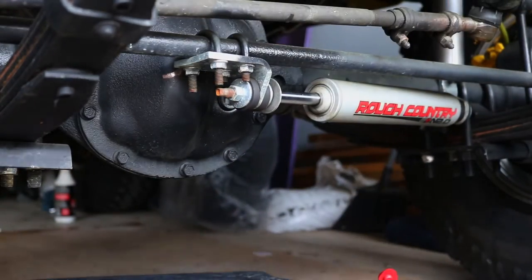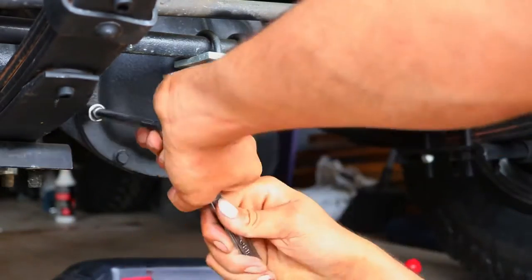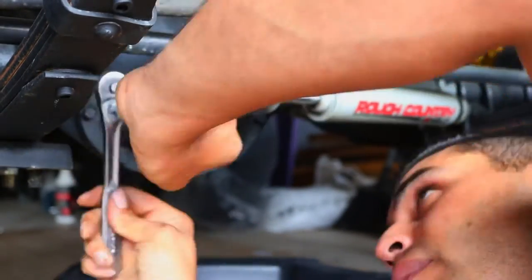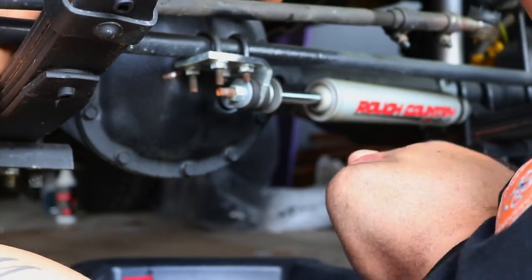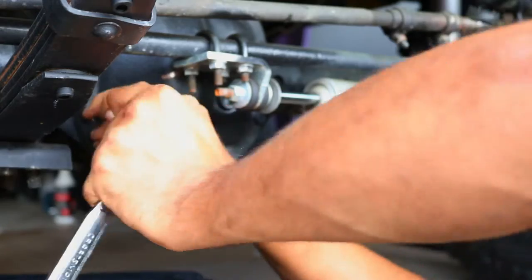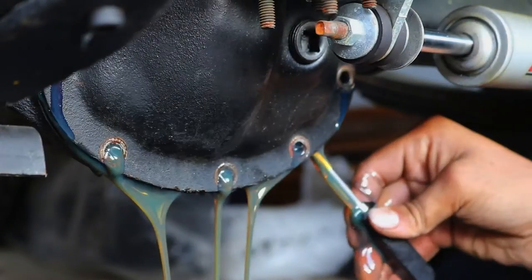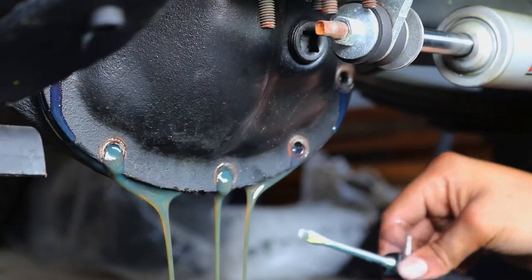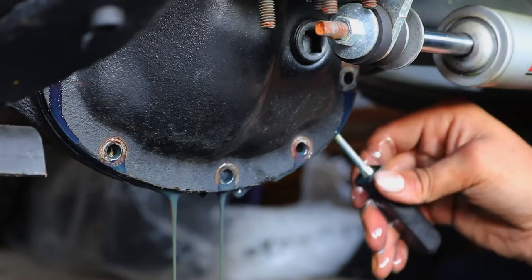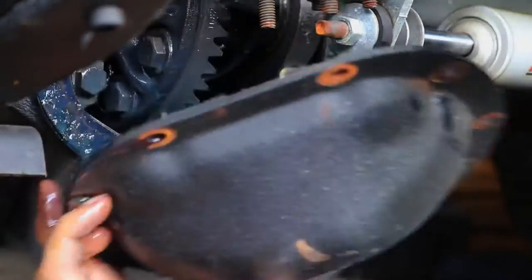I also want to point out that these axles were reused from the original 1983 CJ7 that we purchased. One thing we wanted to make sure was that the Jeep didn't see any water or get submerged in mud, so it's important to check the fluid and more importantly check the gears. As I start prying on this, the fluid looks pretty dirty. One thing I was worried about was the gears but everything turned out okay.